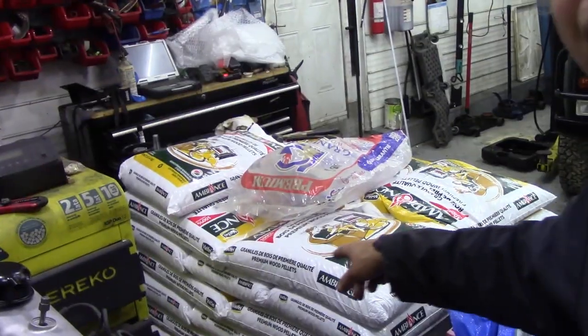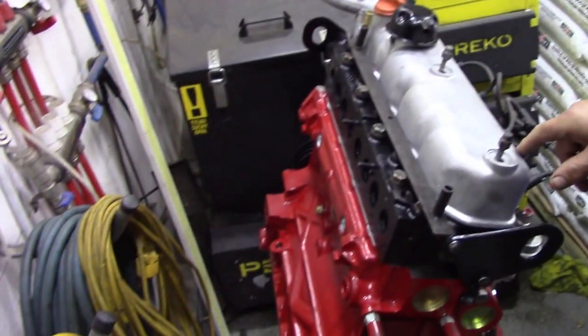I've got my wood in for winter down here — just last year's, so I'm going to use this up. Another thing you'll probably see down here is the 2.5 engine. There's a story behind that: I realized you cannot do the valve timing, the ignition timing, or put the skew gear in until you have the head on. Nothing wrong with that — heads on — only I forgot to order the core plugs that go in the head. I took them out to sandblast inside the head to get any corrosion out.